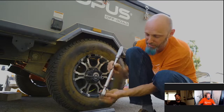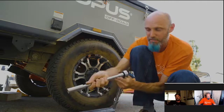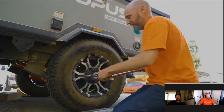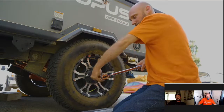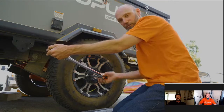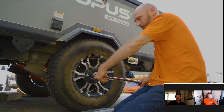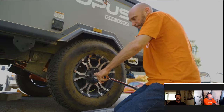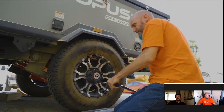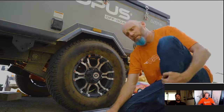There's a bearing on the torque wrench: pressing the button releases it, and lining up the hole in the extension keeps it from coming off. I'm going to hold the shaft and press down — let gravity work for me rather than putting strain on my back. Rotate it around, press down on the torque wrench until it clicks. Just like that — now we know the lug nuts are tight and they're not going to fall off on the road.